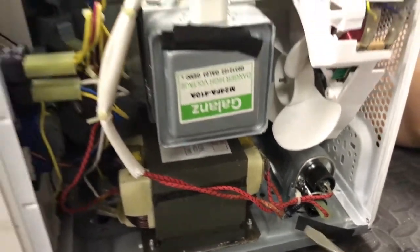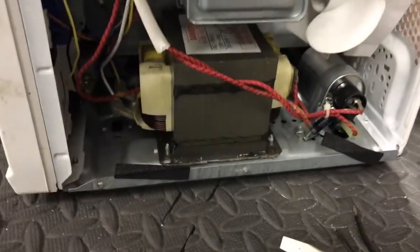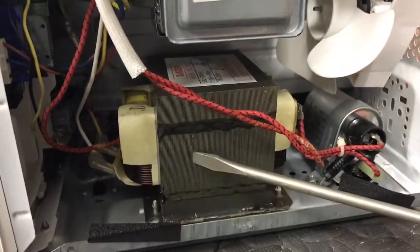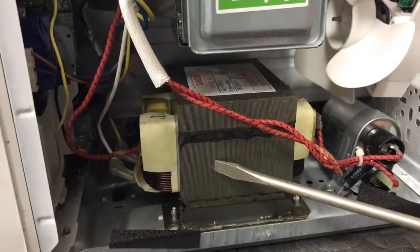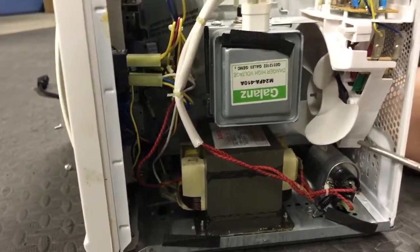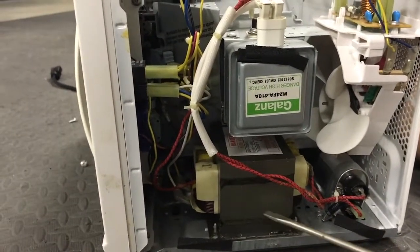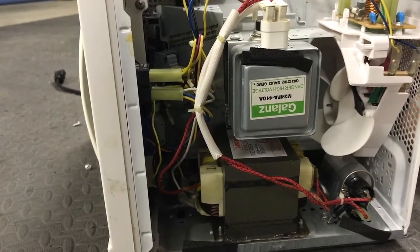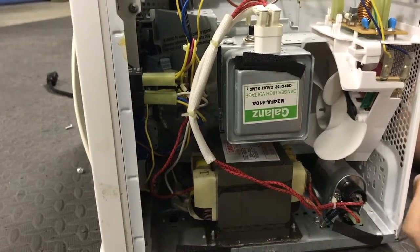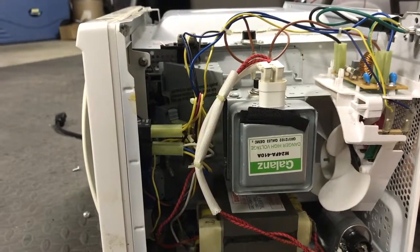You're gonna want to test the capacitor before you even bring your fingers close to it. That right there is a seven kilovolt diode — it can come in many different voltages. Then here — this is exciting — this is the microwave oven transformer. You can touch it after you've cut these wires, because it's hooked up to the capacitor. It outputs a voltage of two kilovolts with peak currents of around 1.5 amps.